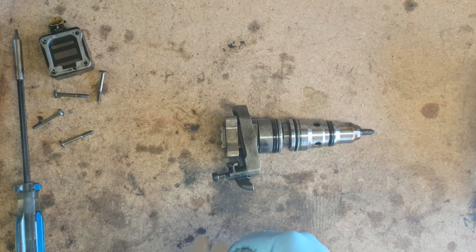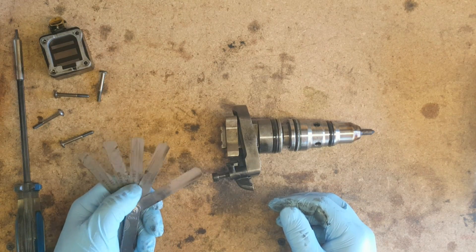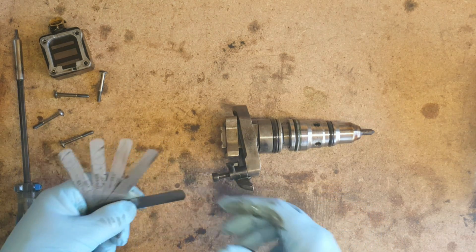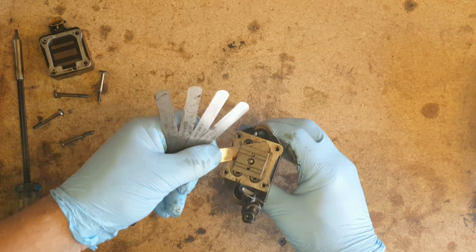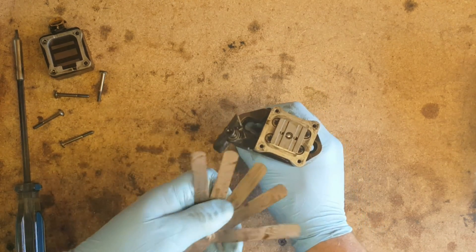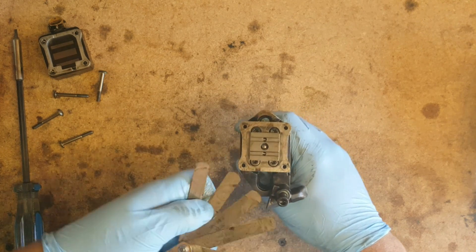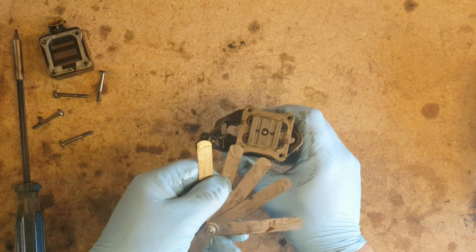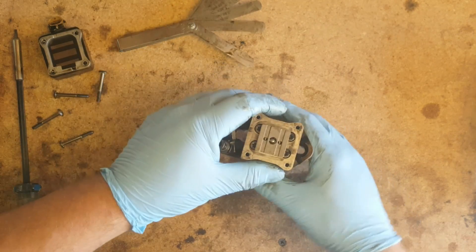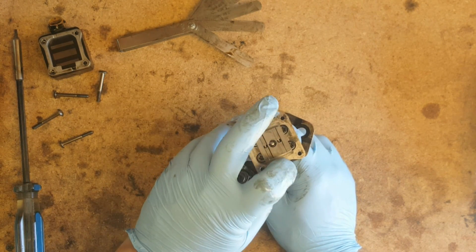So what we're going to do is check the clearance with feeler gauges. I've got one and a half thousandths, two thousandths, two and a half thousandths, three thousandths, and four thousandths. A brand new injector is right around four thousandths of clearance. Starting with the smallest — that fits under and all the way around. Two thousandths fits all the way around. Two and a half thousandths fits all the way. Starting to get a little tight at three thousandths, but that's not bad. Four thousandths doesn't fit at all, so the clearance is between three and four thousandths. That poppet body is still good — the lower seat's not worn to the point where the armature plate is too close to the body.